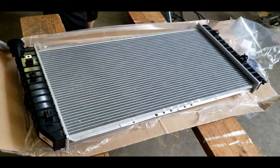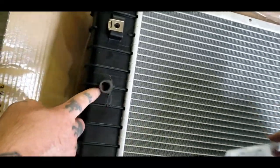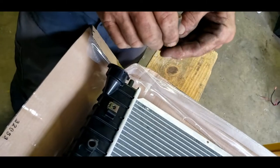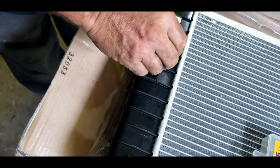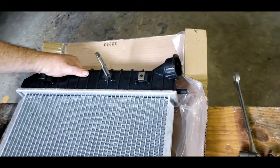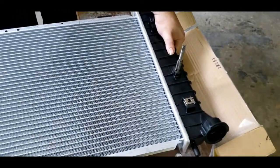We're going to fix this and show you how to install it. Once you find the O-ring, we got an O-ring kit here. We match the O-ring up basically with the size of the bolt. Now that O-ring will hold more pressure than that bolt. Now we are running the tap down in it - that way we can make our threads, because you don't want to force threads, especially in something so brittle. Then we're going to cut our bolt down to size.